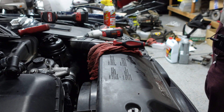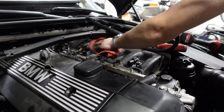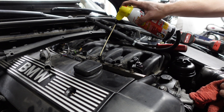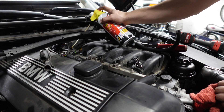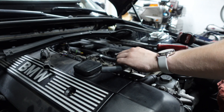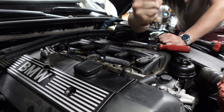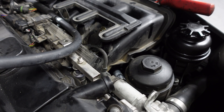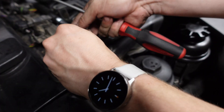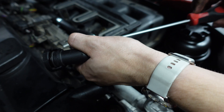At this point you should have a nice PCV valve assembly. Now we're good to put the air distribution manifold back in. I cleaned each of the holes with carb cleaner and a rag, and I'm putting a little bit of lube in each hole to help it all install nicely — and also to make a really fun smoke show when we turn the car on. Then we cut and attach the remaining two hose bits and give them a good tighten. That's not half bad. Let's put the top half of the car back together — and there's one thing we need to do from underneath.